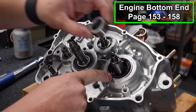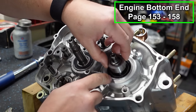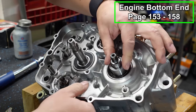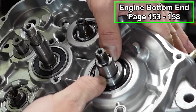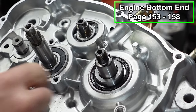And then on our clutch side, we're gonna put this collar in place. And don't forget to make sure that crank seal has grease on the inner lip. And we're just going to gently press this in place. You want to make sure that you don't roll the lip of the seal. And we'll just press that till it bottoms out. That's good. And then we have a seal retainer